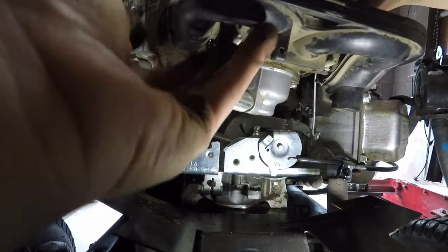I think I've found the problem with this carburetor, other than it being filthy. I noticed when this is flipped over, those jets fall right out of there. So that means gas is just getting around them and they're not doing anything. I've got little O-rings from that kit, and I'll take this out. I'm going to take one out at a time because one is bigger than the other, and I don't want to mix them up.